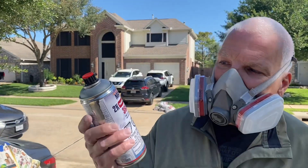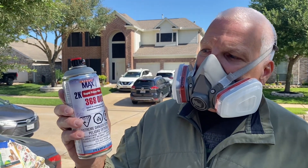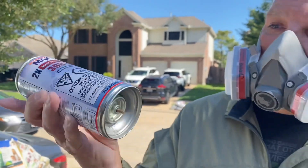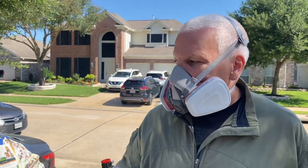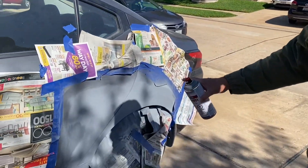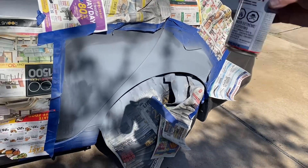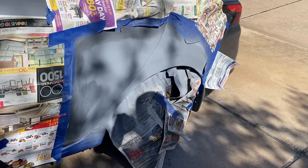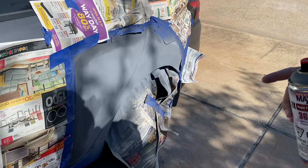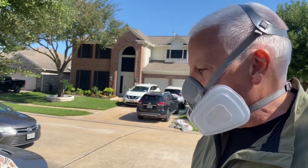This is what I used, as I was told to by Chris — 368-0031. It's a rapid-fill primer, a two-part primer. You've got to click it in. I've got one coat already block-sanded out. There are three coats total — I put three coats on it and blocked it out. Now I'm going to put one last coat on here in 10 minutes after it flashes off. After that 10-minute flash, I'll lighten up my last coat, then wet-sand it and be ready for paint next weekend.